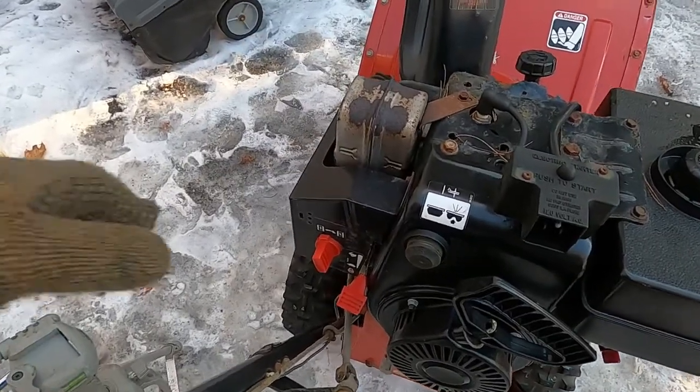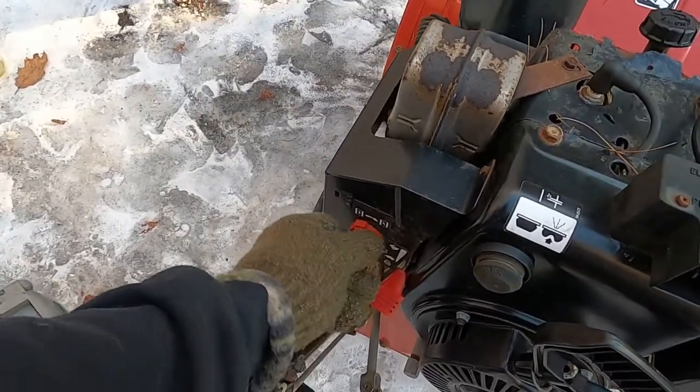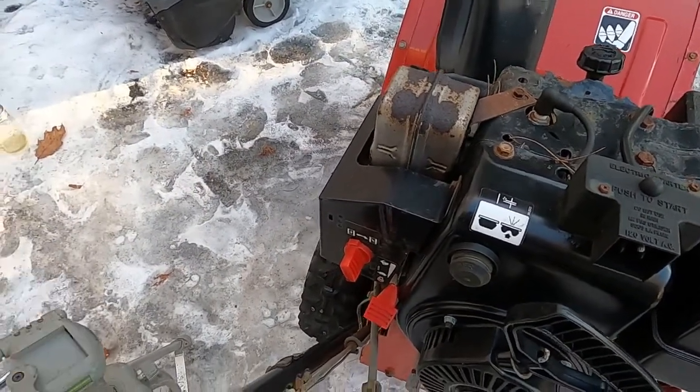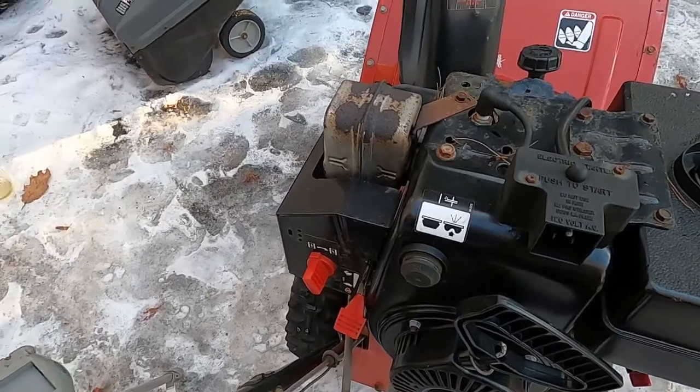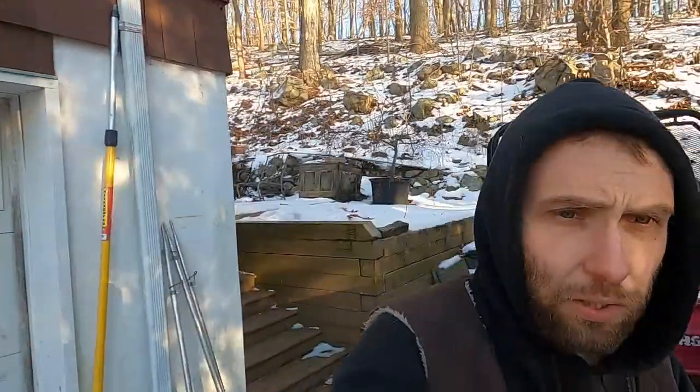You can hear it searching. I could get it to run smooth in the first three choke positions, but I couldn't get it to run properly off choke. I've been messing with it for about ten minutes and it's properly warmed up by now. So throwing new fuel in it went pretty far. What we're going to do now is re-drain the tank per the instructions, re-drain the carburetor, put the full four ounces of Mechanic in a Bottle in, and come back in four hours. The test has a very clear success/failure mode: either it runs fine off choke or it doesn't — right now it doesn't.